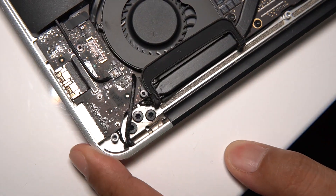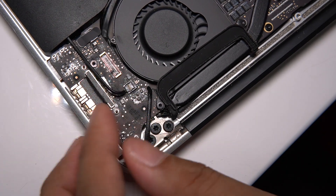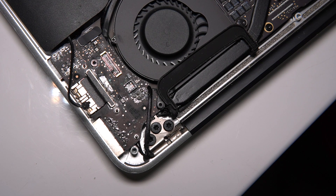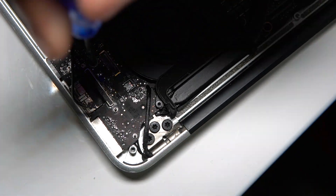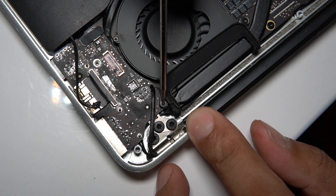After you remove that ribbon cable, go ahead and take off this cable. Make sure the battery is disconnected when you do all of this — just do it like that. Make sure the battery is disconnected because if you short anything you could do more damage than good. After that, go ahead and take out the screw there — got that screw out in the middle. The next thing is we're gonna have to take off the fan because it holds it down here.